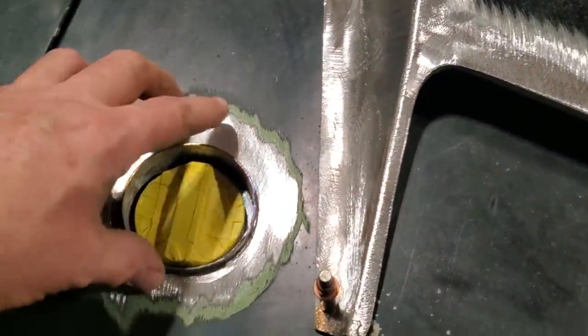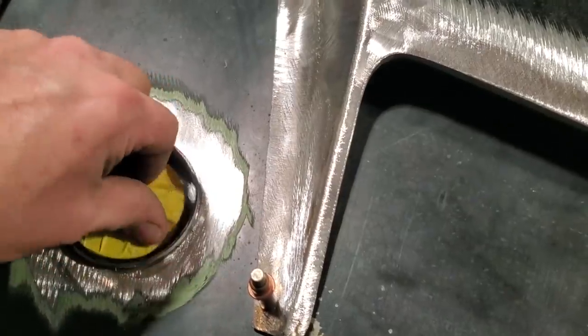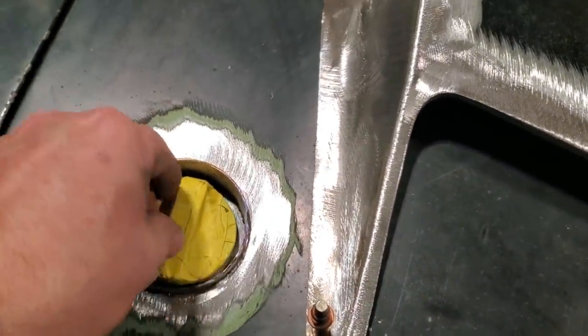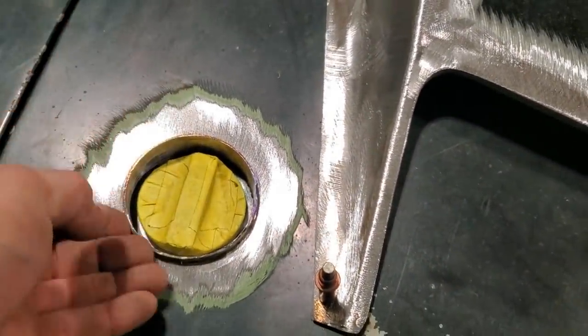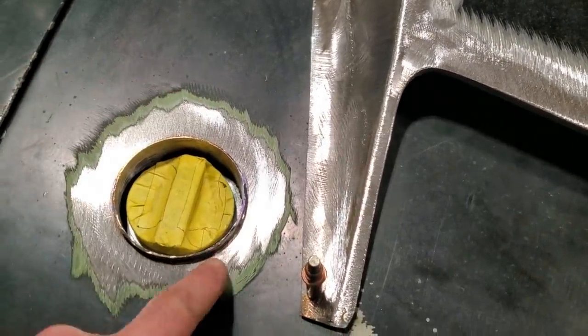I just cut it and used a grinder to open it up and to fit it down. And I got the clips put in place, and they work really good. They lock in place, as you can see. All right. And all I got to do now is pull these up so they're comfortable and there's not too much of a strain on this here. And then I'm going to tack weld this around here.